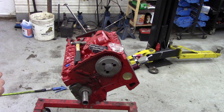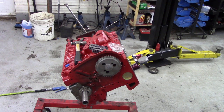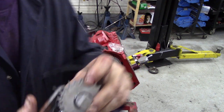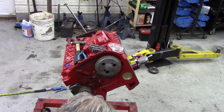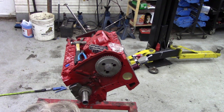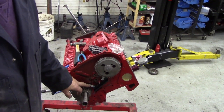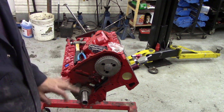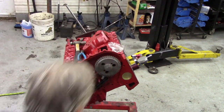So I'm going to fit this on. It is a complicated thing because there's a flat on here that sits in this flat here, so you've got to line up quite a few bits and pieces at the same time. Should I put the tensioner on first? I think I'll put the slipper on first. Right — I fitted the tensioner. I didn't quite have the right lock tab washers — I forgot to order them — but I used the same tab washers that were on the cam. They'll do the job. I'll put some Loctite on them as well so they won't come off.